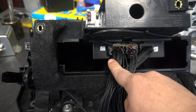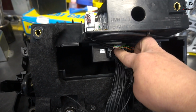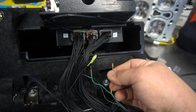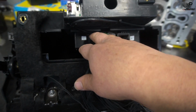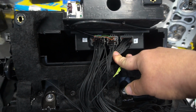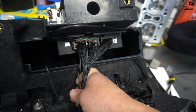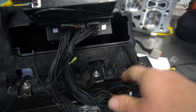And usually when this is in the engine bay, it's really done because of convenience. Easier to figure out. Just remove C35 or C12 and just put the pin in there. The problem is when you start adding 5 or 6 sensors and you have to tap 5 volts 5 different times, and tap the ground 5 different times, and it just makes it very ugly. When it's in the engine bay, it's not exactly the nicest way, and you really don't want to start cutting into the original harness. That's not really the ideal way, especially on a high powered unit like this. So many things can be affected by just a bad crimp or bad connector. You want to make this as nice as possible.